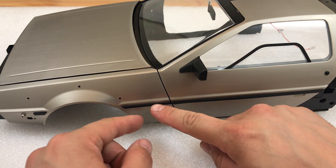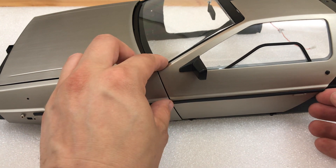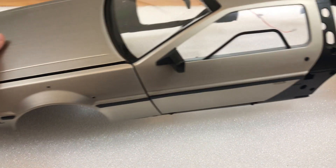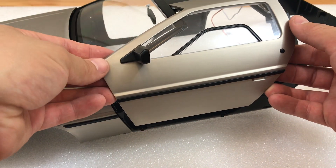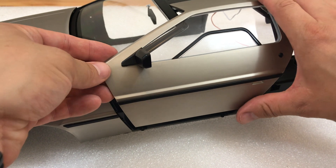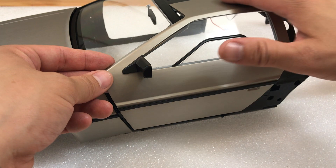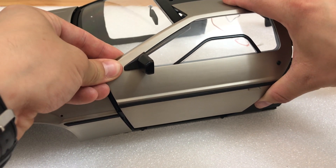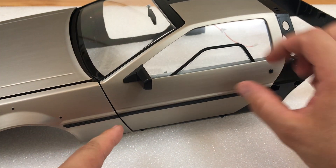If the wing didn't fit — it was quite low down — the way you can deal with that is: lift the door up, then pull this section up and push this section down. You want to do a twisting motion. Hold on top here because you don't want to bring it off its hinges, and twist it up like that — that will bend the metal so it lines up with the wing.